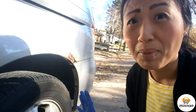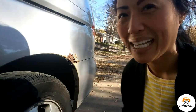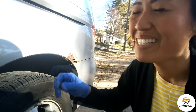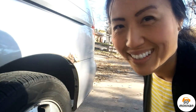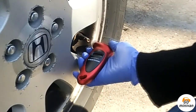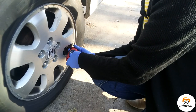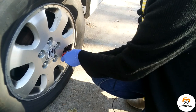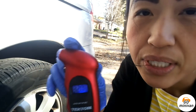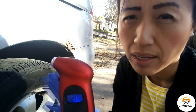I just want to say, so far I'm loving this little device. It's digital, so it has a clear reading compared to that stick that pops out, which gives a really hard time getting a clear reading. The rear tire is at 32 pounds per square inch — much better. So the front tire is pretty under-inflated.